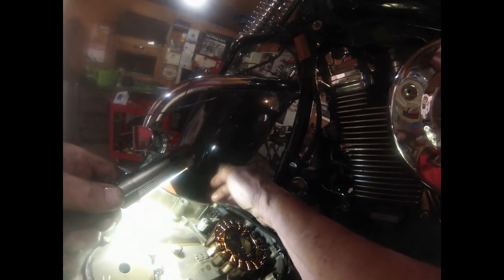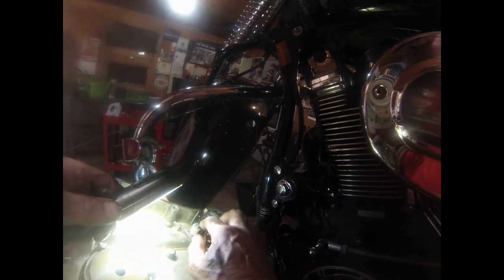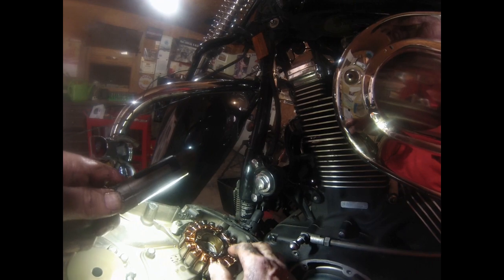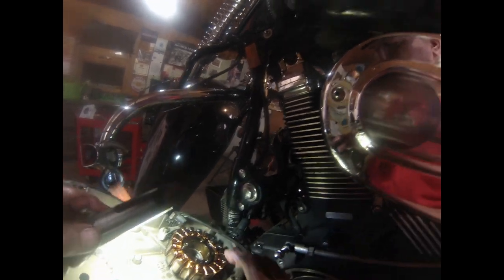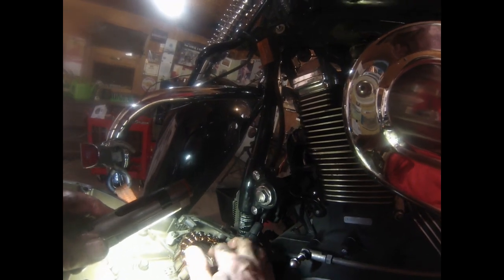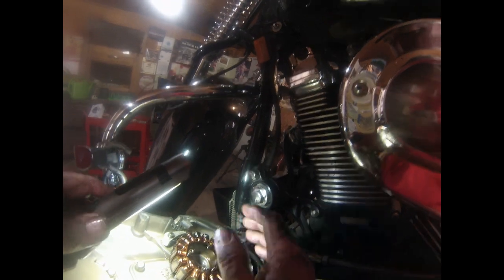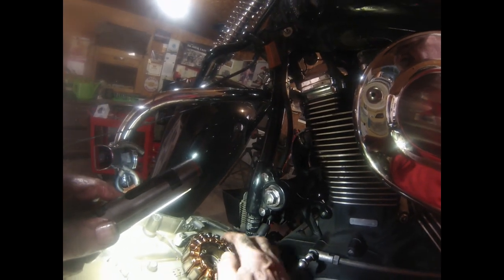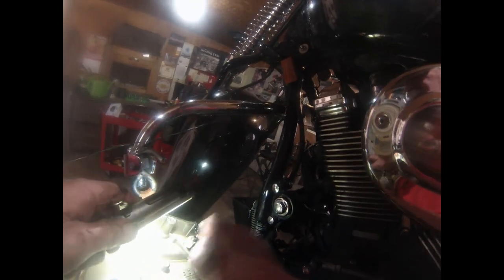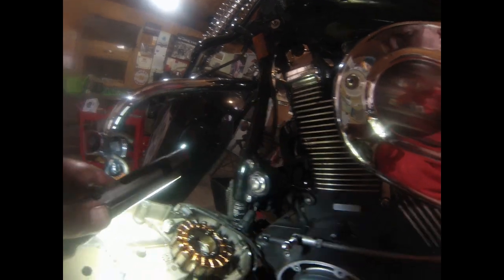As you remember, the wire comes in the top of the case here, and that's not stock. I had that made. I'll talk about that in a second. And you just take these three screws out. Now, it has to be clocked or turned perfectly underneath, or those holes won't line up right. Make sure when you get these three screws back in that you're clocked right, because the lead, this is the wire, has to be positioned perfectly over here.